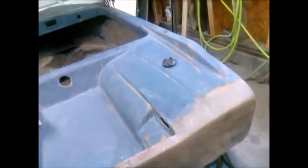So I made these little three-inch fiberglass tabs and resined them up on the inside, so they would bond from the inside of the hull to the transom all the way around the whole entire transom. That way, it would encapsulate and bind all of the wood to the boat itself.